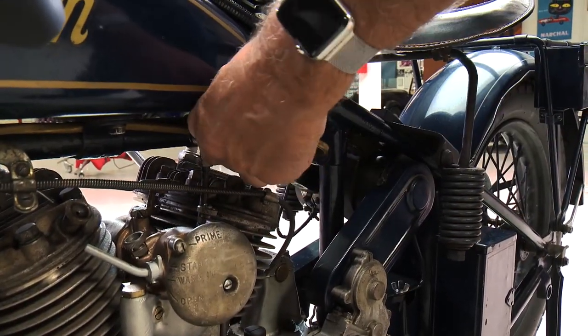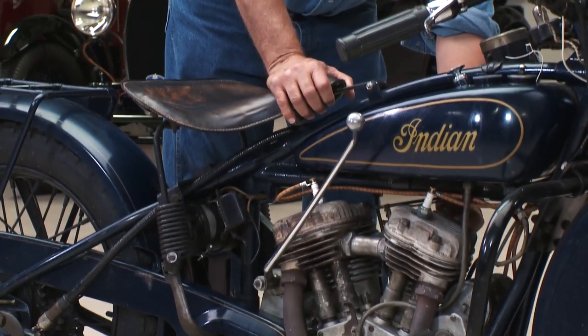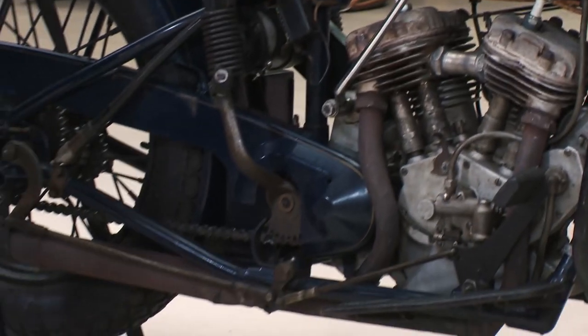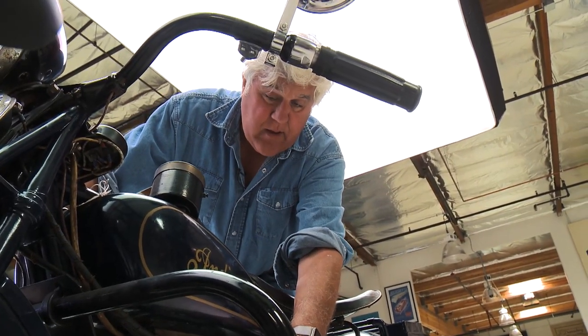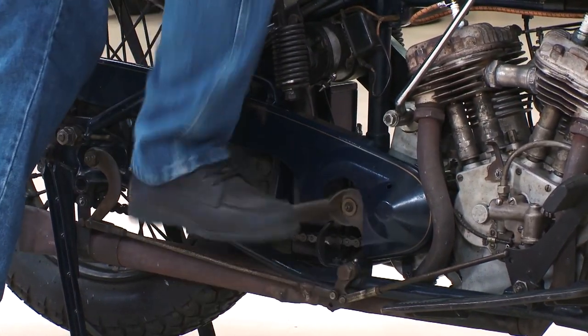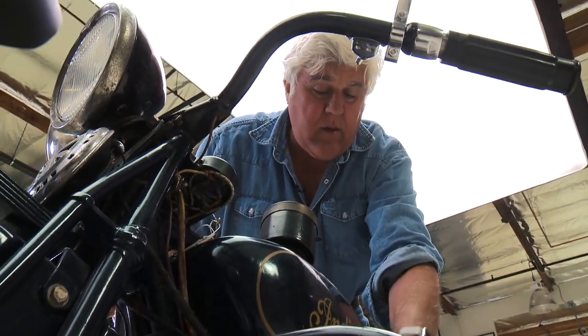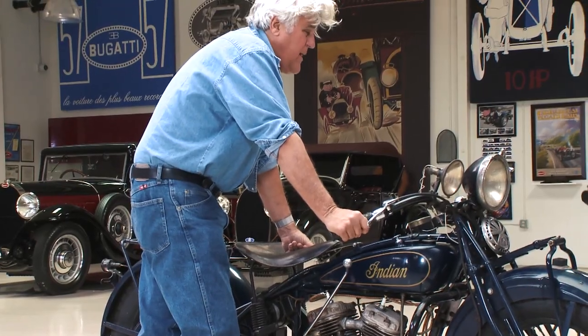The engine's cold, so I'm going to turn on the fuel. You don't have to tickle these like you do British carburetors, but you might want to put your choke on or your prime and maybe give it one or two kicks just to pull some fuel into the cylinder. Just like that. Open that up. Adjust your spark a little bit. Let's see what happens. As you can see, very sweet running bike. Being a 750, you don't break your leg trying to kick it — just kind of drop your foot through when she starts. Probably six and a half compression ratio, something like that. So it's easy to start. Runs cool.